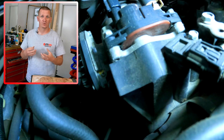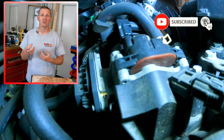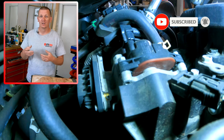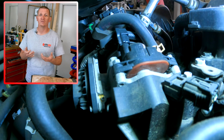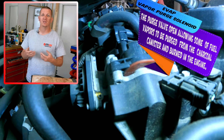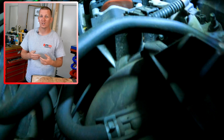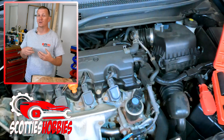If these valves or solenoids go bad, you can do a 9-volt test or a vacuum hold test — using a 9-volt battery, just see if this solenoid will hold vacuum. It should hold about five to seven inches of vacuum pretty steady, and then if you apply voltage to the solenoid, it should open up and release that vacuum.